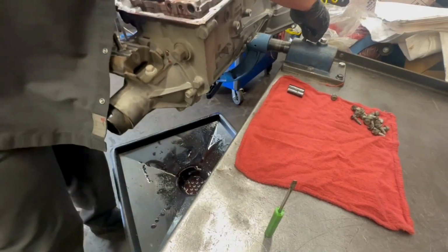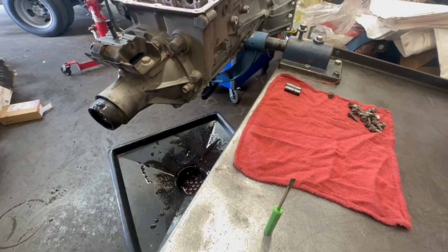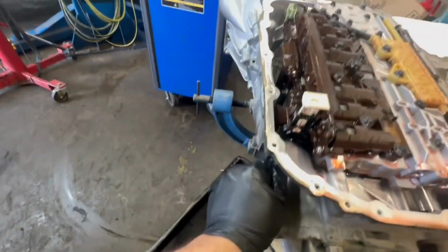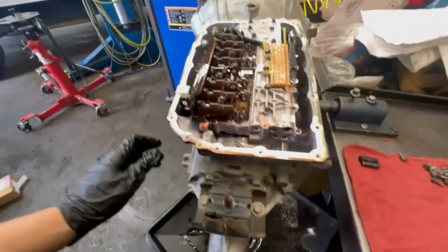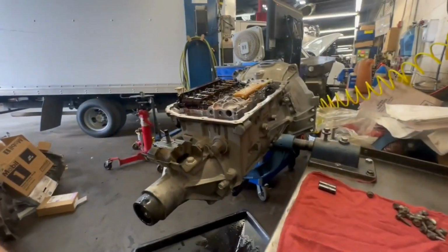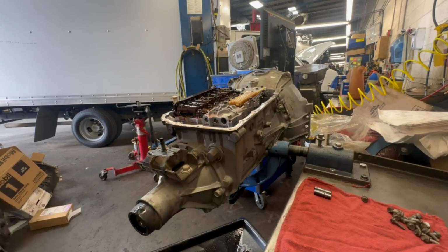Alright, I gotta get the valve body out now. As you know, you got to get the housing for the little clip in there for the harness. You lift the white tab up and then pull it out. I'm probably gonna have to get some pliers after that. After you pull that out, then you can take all the inverted Torx bolts out, and then from there you can take it out.